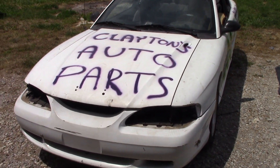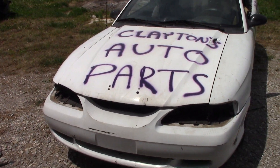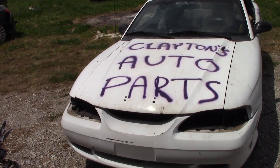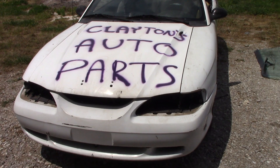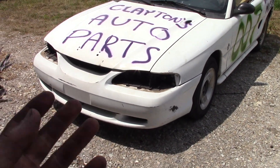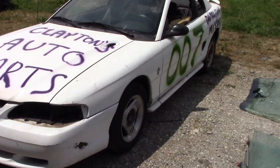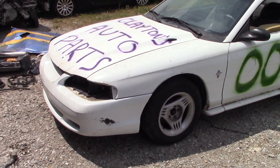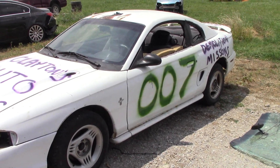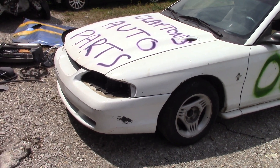The only issue we're going to fight is we don't know how fast that back cylinder actually fills up with water — it happened overnight, so we don't know if it takes an hour or several hours to lock up again. Our plan is pretty much every half hour we'll start this car up in the pits, let it run for a couple minutes so it burns off any water in that cylinder, then turn it back off, keep repeating to keep it dried out as long as possible. Once it's in the enduro race, if it starts blowing, overheating, or drops a cylinder and runs on five, oh well — we'll do what we can until this thing's gone.